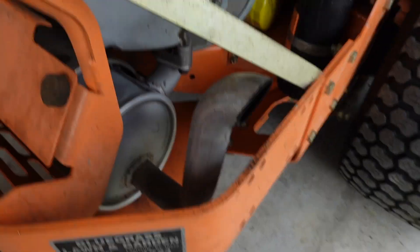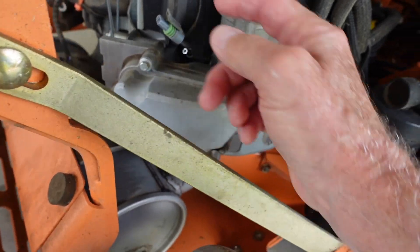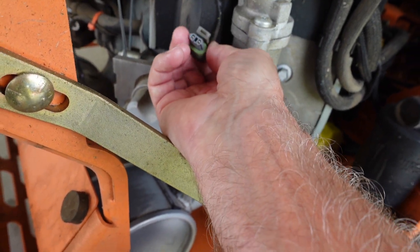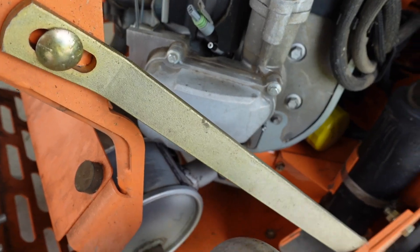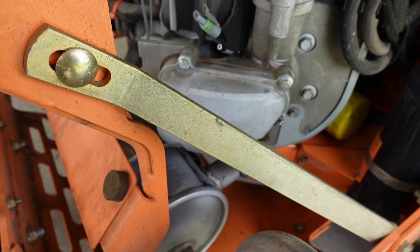The coil is very easy to take off. This bolt was used for this clip right here, just for the plug wire, so I will be removing this and putting it back on. And then just 2 bolts up here — that simple primary input, just 2 wires and a single clip. And carefully reinstall your plug wires. We'll go ahead and get the new one on and see how it sounds.